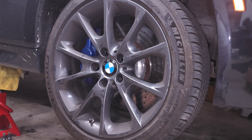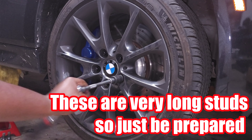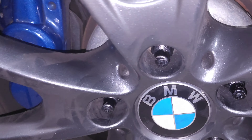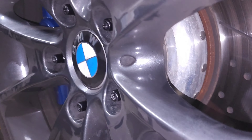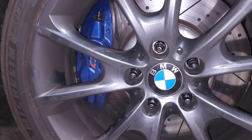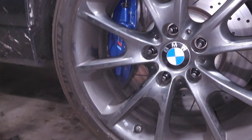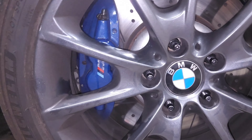I will need to add a spacer with the OEM wheels. These are extremely long but the nice thing is that with up to a 15 millimeter spacer, this length of stud works with it — you don't need any longer bolts or anything like that. It pretty much sits flush with the face of the wheel and still allows you to run that much of a spacer. Overall it gives added security and ease of putting the wheels on and off for track days or if you just like swapping wheels seasonally.